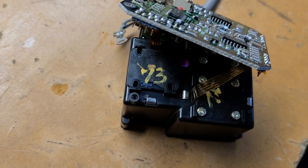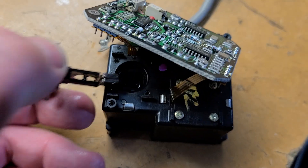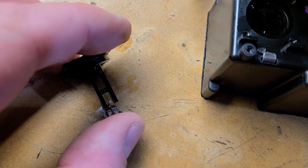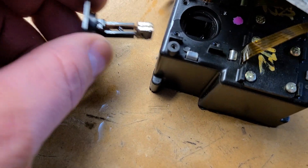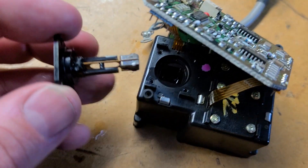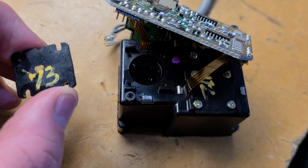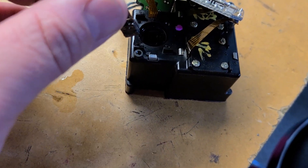You can see how the G-sensor works. There's a little bit of fluid in there, and it's magnetic inside, so as this pendulum swings back and forth it's one of the inputs for the ATESA system — the all-wheel drive system. This is the side-to-side axis.